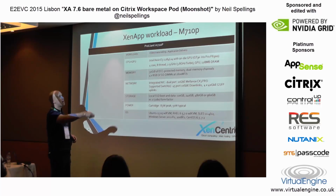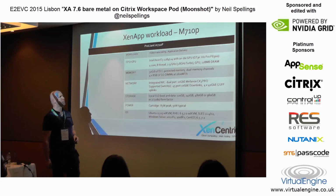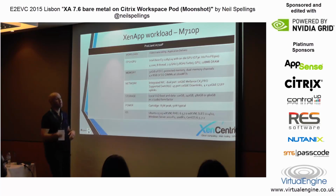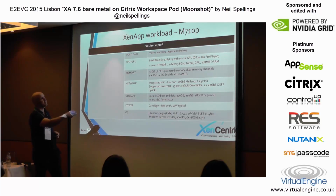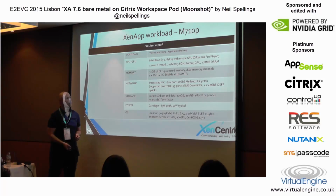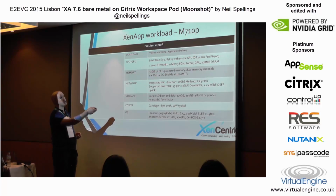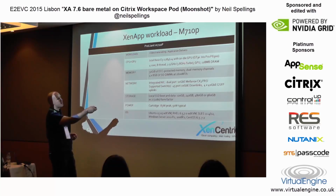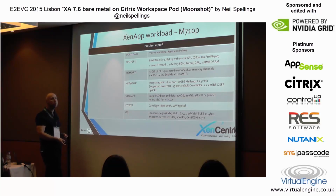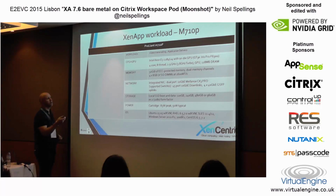These people, the M710, they still do them, but there's a slightly updated one called the P. I think it's Performance, I don't know what the P stands for. But anyway, it's basically a CPU revision, so it's got slightly later Intel Xeon than the 710. 4-core CPU, 8 with hyper-threading. The CPU rev has increased the frequency of that, so this is now almost 4 GHz in turbo mode. You've got 32 gig of ECC RAM on each one, and you've got an integrated GPU, which is great.